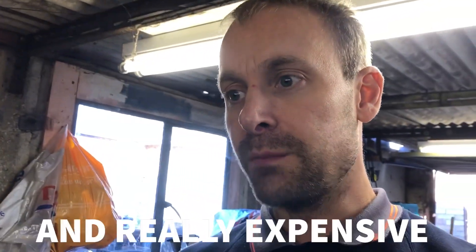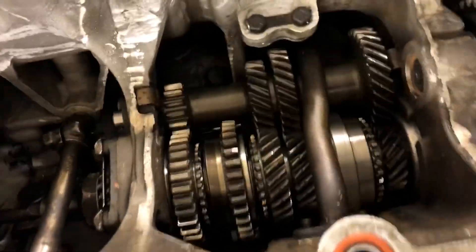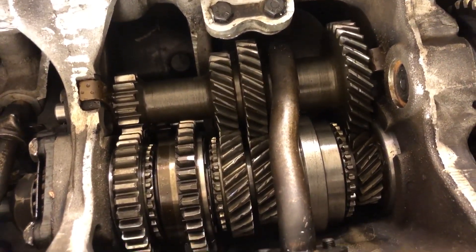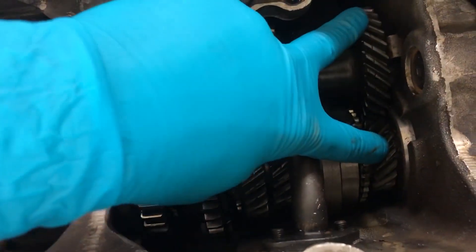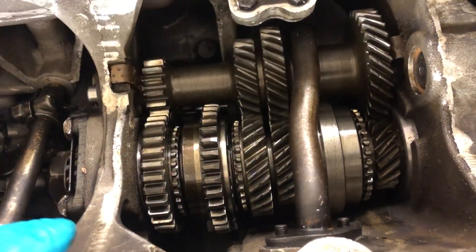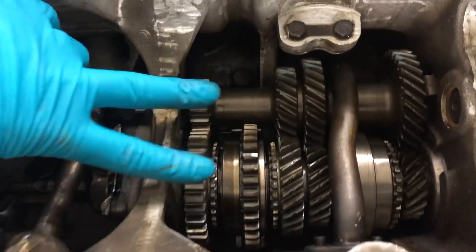Getting hold of pre-A plus gears is a bit tricky, so I've got a stash of many, many dismantled gearbox parts I've gathered over the years - partly from gearboxes I've wrecked, partly from ones I've just got stripped and taken apart. I've kept the casings because you never know when you're going to need something. What I've done in here is use the gear set from an SPI Cooper. It's slightly different; the sizes of these gears are slightly different, but I believe the ratios work out largely the same. It'll work out nicely for the 998 that this is going on, so the A plus gear set will fit in here.